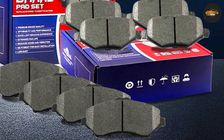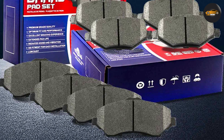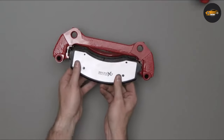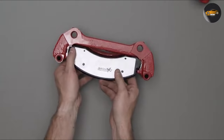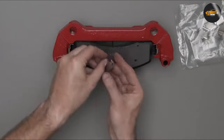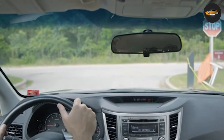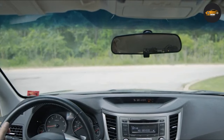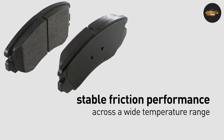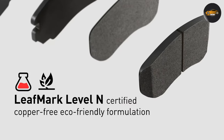On the flip side, ceramic brake pads may lack the raw stopping power of their metallic counterparts, but shine in terms of noise reduction and producing minimal dust. Speaking of noise and dust, this is where ceramic brake pads really shine. If you are tired of those ear-piercing squeals and constantly cleaning your wheels, ceramics are your best friend. They keep your wheels cleaner and offer a peaceful ride. Semi-metallic brake pads, though excellent in performance, can be noisier and generate more dust, demanding regular cleaning and maintenance.